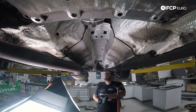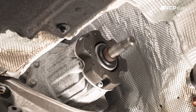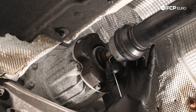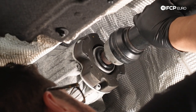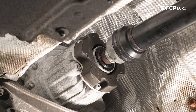At this point we're going to go ahead and install the drive shaft. We have the new Oetiker clamp pre-loaded onto the end of the drive shaft already, so it's ready to rock and roll. We're going to slip the front end first — give it a good push, make sure it's all the way in — then we'll feed the CV joint back here, and then get our center support bearing lined up. We're going to feed the front end again — make sure our splines are lining up. We're going to need to open up this circlip inside the boot once more, then push it in the rest of the way. Circlip is out, boot is in — our Oetiker clamp is on there.